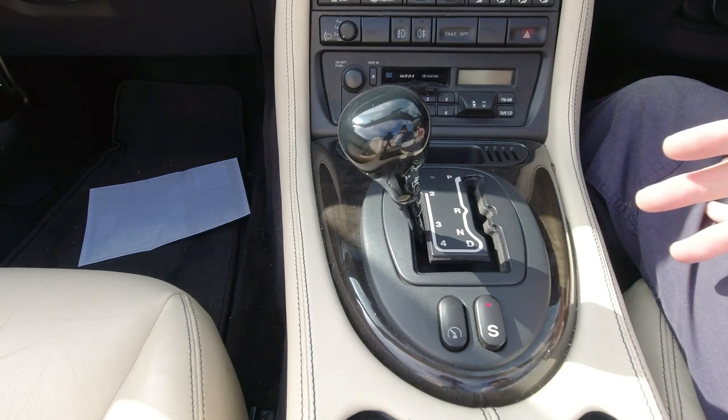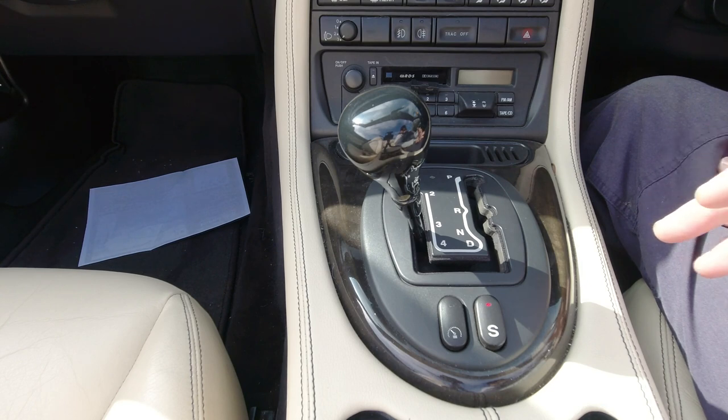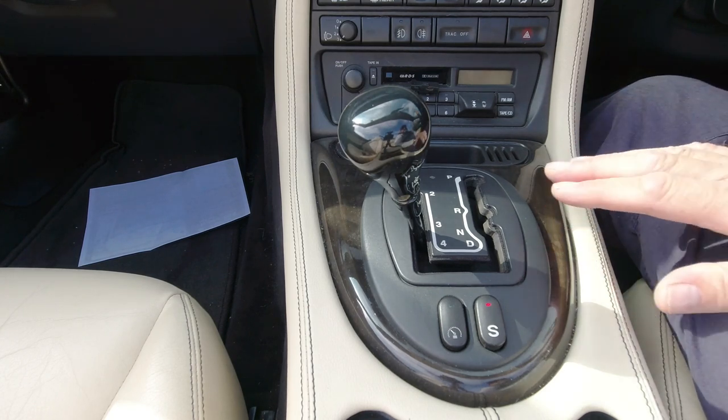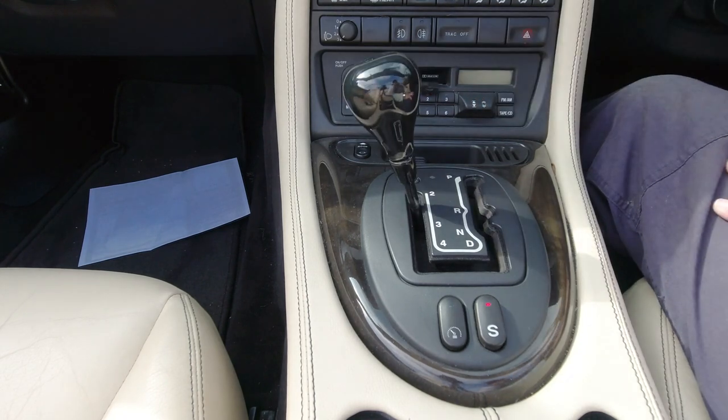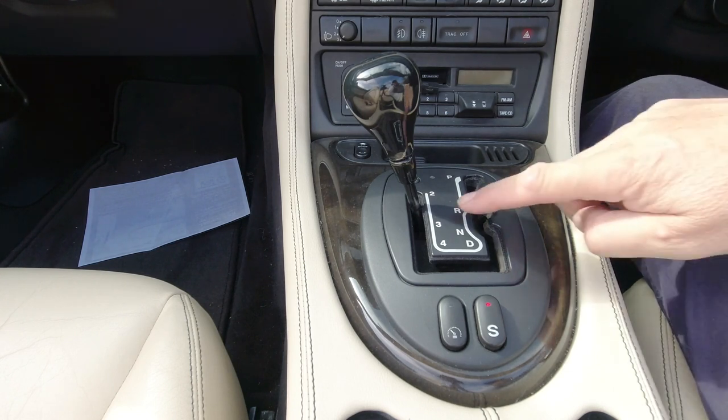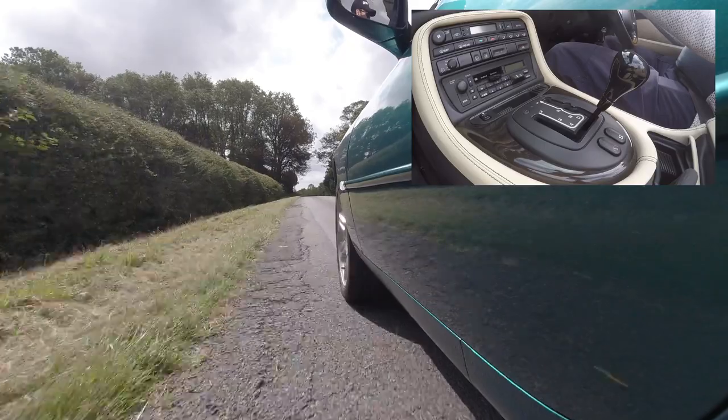It becomes really steep. Let's say you're going down one of our classic passes, like Porlock Hill, for instance, which is about a 25% gradient. I don't care how brave you are or how empty you think the road is. You should be sticking it there, and that will give you quite a lot of engine braking, which you're going to be supplementing with a foot brake, but you won't ride the entire mile and a half down the hill with the brakes on full, because the engine will slow you as well.